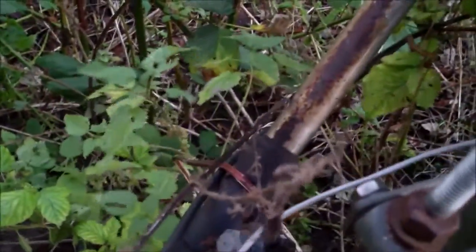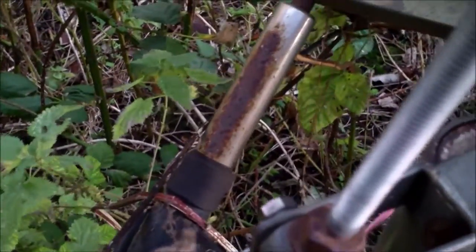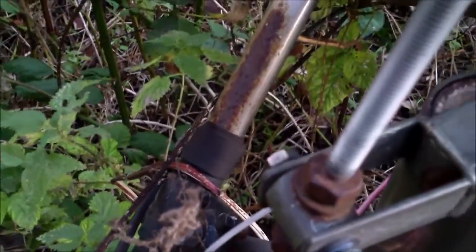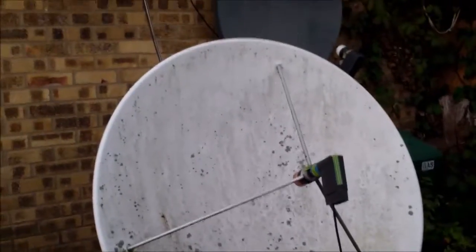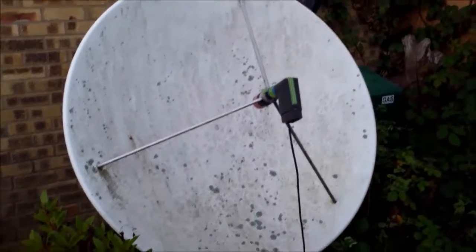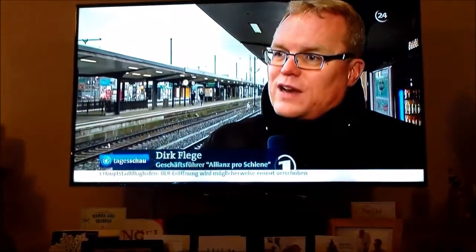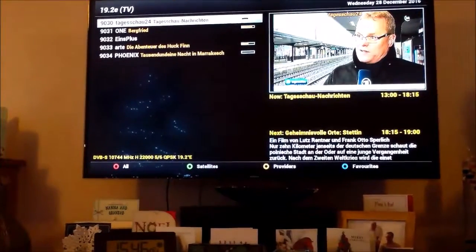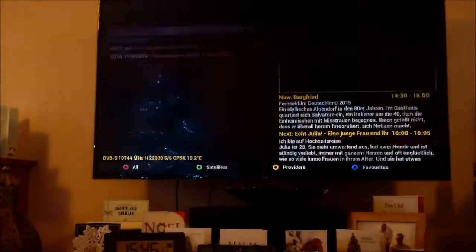You can see the dish is quite poorly maintained — it was last maintained in 2009 when it last broke down. The dish moves quite freely, with the actuator being broken. I set it to the last position it would be in. You can see the quad LNB has been modified to fit this dish. Going back to the television, it's now tuning in Target Show, and we can tune in other channels quite clearly while the dish is stuck in the jammed position.